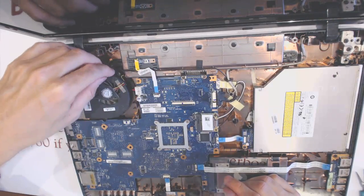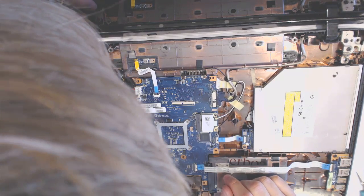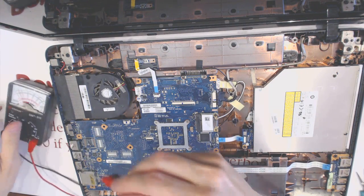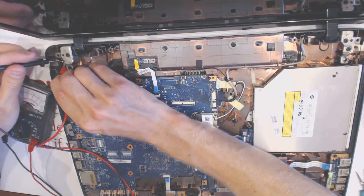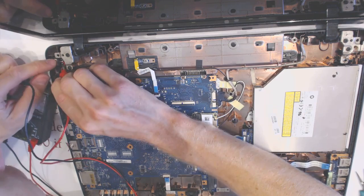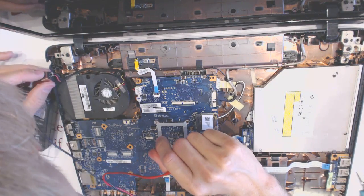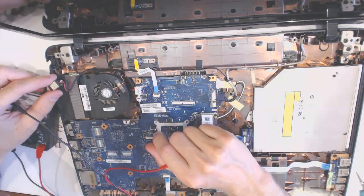Yeah, it's really hard to say if somebody was screwing around with the jack before, because it doesn't seem like it's the way it's supposed to be. So let me see if the unpainted surface here conducts electricity. Crap, yeah. So the problem is the surface right there behind the jack does conduct electricity, and that's probably the reason why the original jack shorted out a little bit.